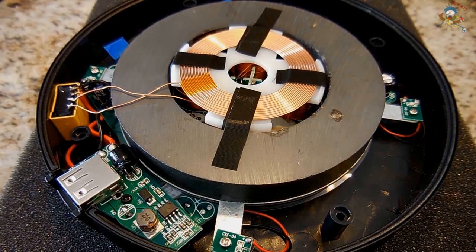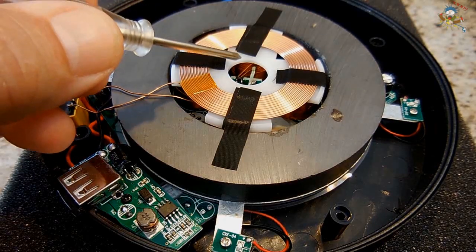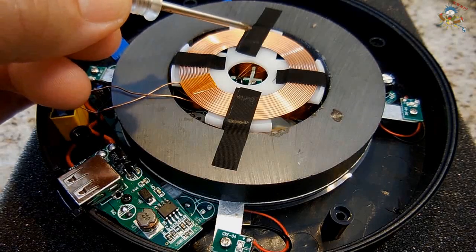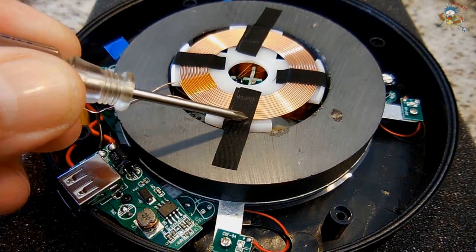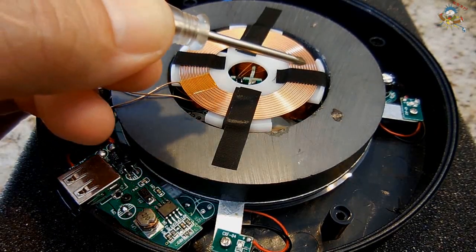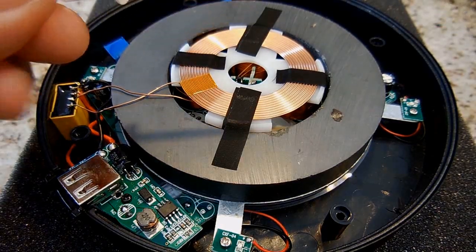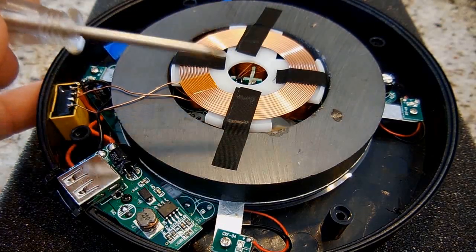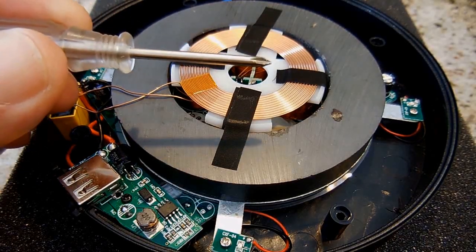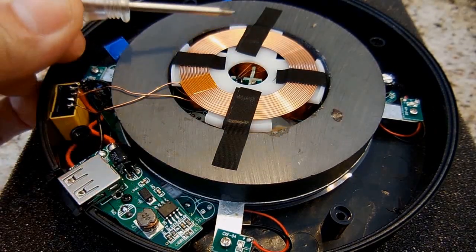Now it's going to be a little difficult to see, but underneath this inductive charging coil, there's another winding, a big one right here, about 3/4 of an inch in diameter. Opposite that one is another one of those same coils. There's another one 90 degrees over, and opposite that one. You have a magnetic field within that ring magnet, and when you place the orb there without those 4 little coils, which are electromagnets, what's going to happen, the orb is going to stay in the middle and then be pulled to the magnet here or pulled there.